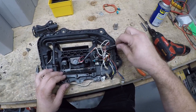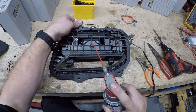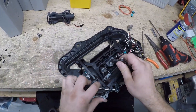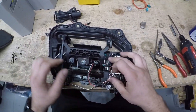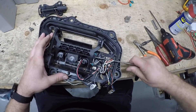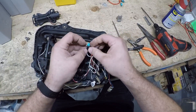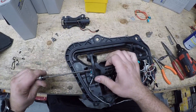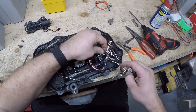It's a poor metal they use, and when the switch harnesses break, the handle doesn't know its position and the motor will force it so hard it blows the gear apart. To get access to the screws we need to back off the depth bolt — but first spray a little lube on it because these corrode in. It's just a brass insert in plastic, and if it's frozen you'll move the insert instead of the bolt. Once backed out enough, you can access the two screws. This piece is aluminum so the screw is a fine thread; the later plastic arm uses a coarse thread.